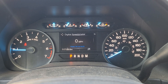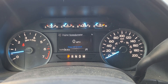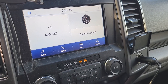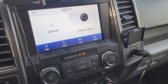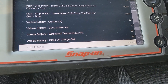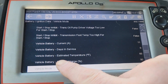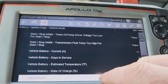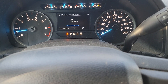It's great to see that manual reset — which basically everybody can do without a scan tool — does work. With a new fresh battery in here, the auto start-stop should work as designed, saving a bit of fuel and money. The entertainment system should run for a decent amount of time after ignition is off. And you don't have to take it to a shop to get the battery monitoring system reset — just flash the high beams five times, press the brake pedal three times, and watch for the battery light to flash. You may need two or three attempts.